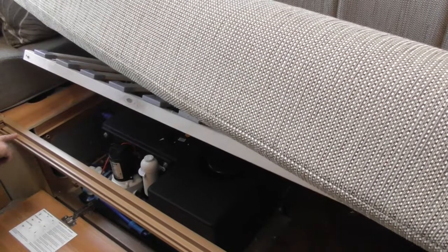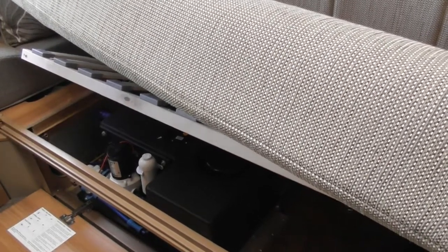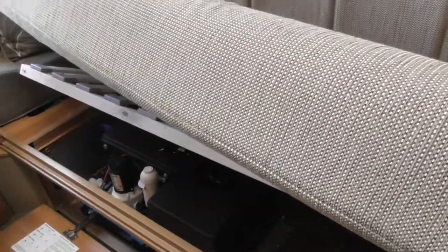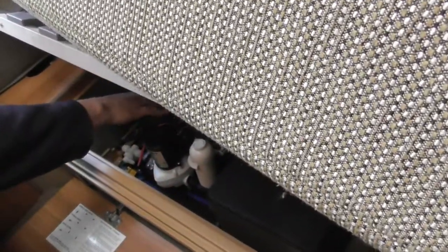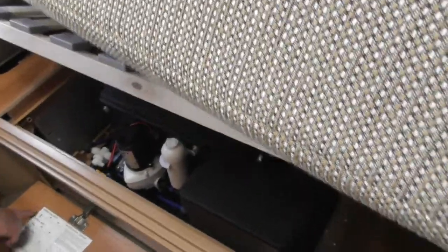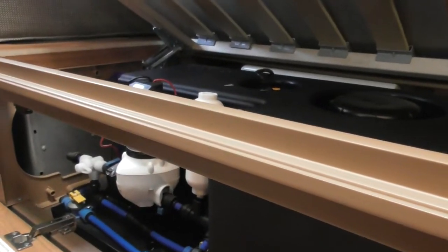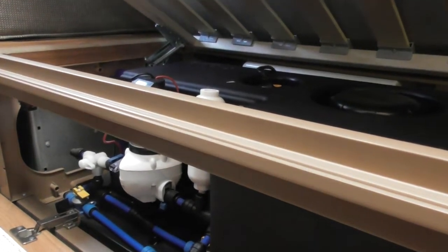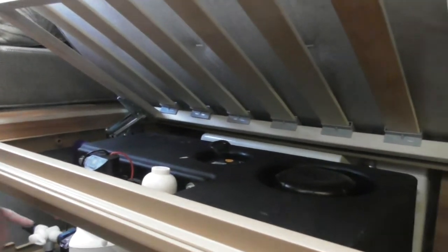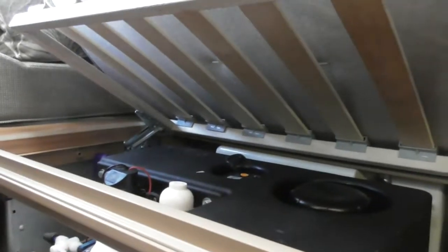The white lever: when it's pointing crossways I always think it's pointing down towards the sink — that's direct to tap, drawing from the aquaroll. When it's pointing straight down, you're drawing out of the internal tank. So it's as simple as that — that's all this lever is, it's just selecting where you draw the water from.